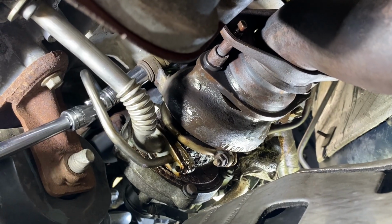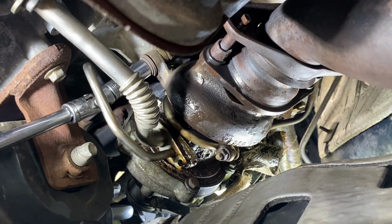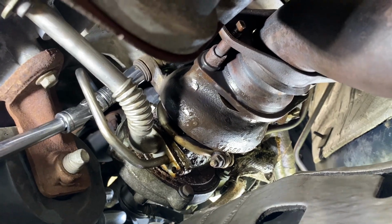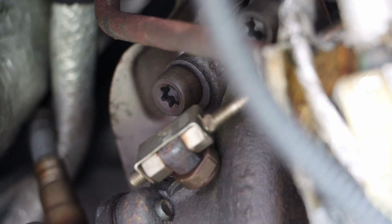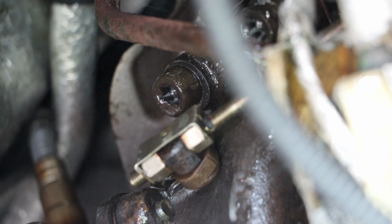And then we have one additional bolt. This is a bolt that goes through the mounting bracket for this turbo assembly, and this is also on the back side. And we can then shift our focus back to the front side and locate the 3 mounting bolts visible from the front. And it would be worth coating these in Amsoil metal protector to aid in the removal process.